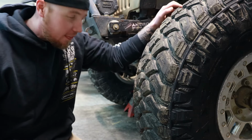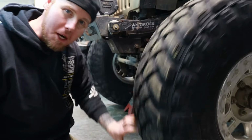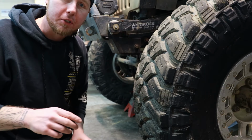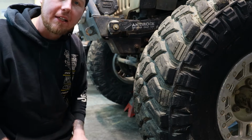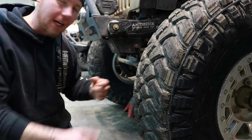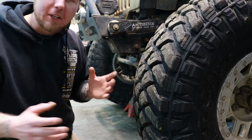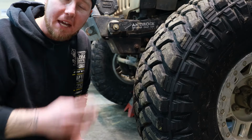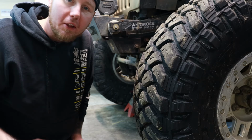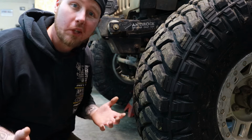Check this out. See how both front tires are spinning the same direction? Well, the locker is off. I have the switch off. There is no CO2 in the lines or anything like that, and it is fully locked. That's not supposed to do that. The tires are supposed to spin the opposite direction when the locker isn't engaged. I've wheeled with it on 4 trips in this condition. I broke it a while back. It works, I just keep wheeling on it, you know, like smart people do. Now I have time to pull the cover off and see what the hell's going on.